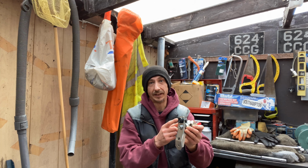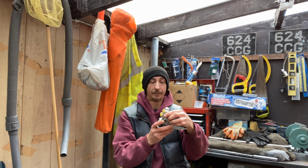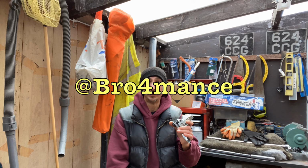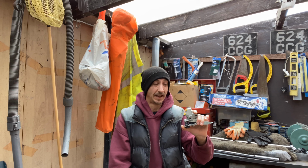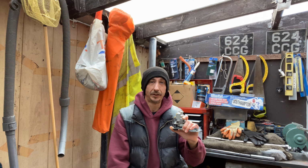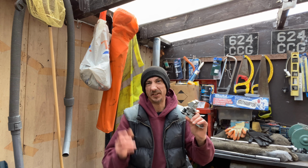Okay, there is also a little 4mm Allen key bolt under here, which people have been using to adjust this preset tension, but it should be preset. The reason why I know this is because I actually went down to the local MOT station. Shout out to Bick again on Instagram. A massive shout out to him because I went down the garage to see what he said. Bit of advice, and again, one of them, he said, anyone that's not confident or even competent in doing this kind of job, don't even think about it, leave it to the professionals. At the end of the day, it is your brakes. I mean, I'm qualified to do this, and yeah, I've got a certificate saying I can do brakes.